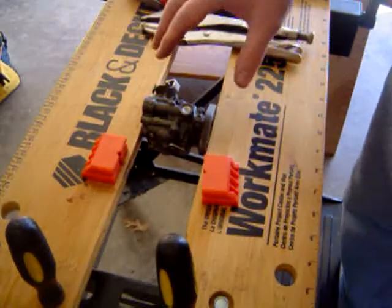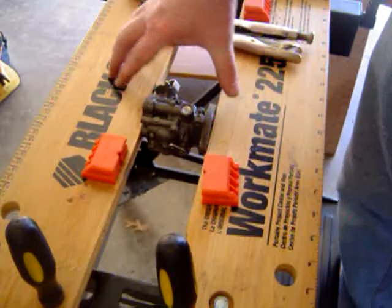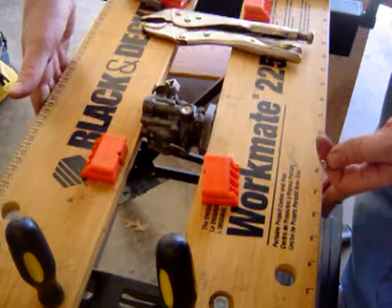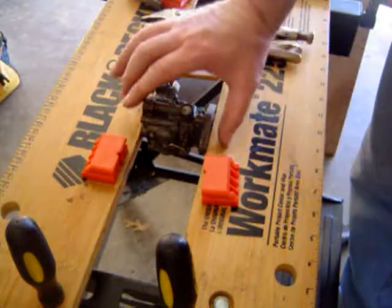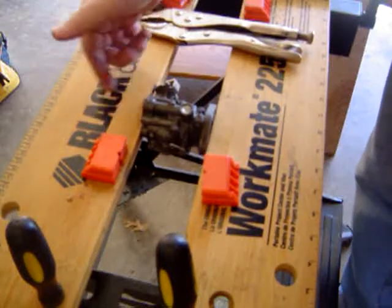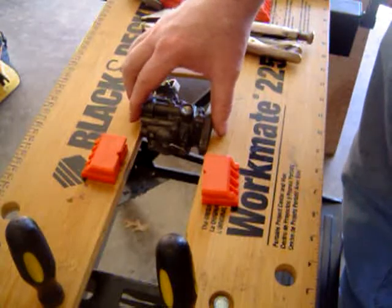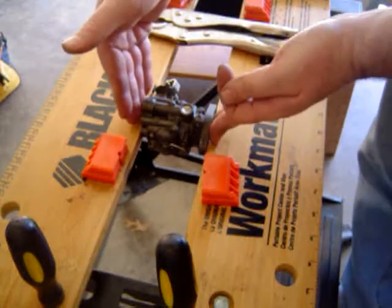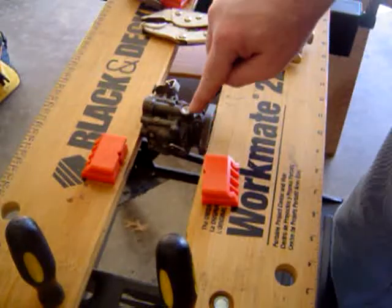I reconfigured the table. I have the carburetor in between these two soft pieces of wood. This table kind of collapses inward and forms like a little vise, so it can snugly hold the carburetor. The flat surfaces are going to the motor and to the front. Be very careful that you're not mashing or pushing them. If you're putting it in a vise, you need to place two pieces of soft wood in the front to protect the carburetor.